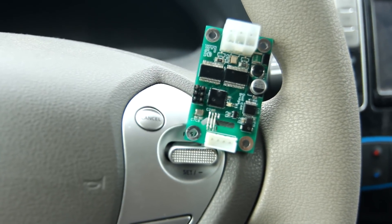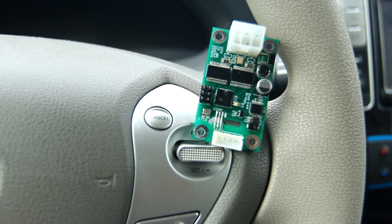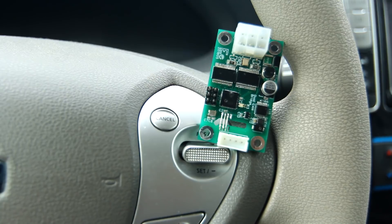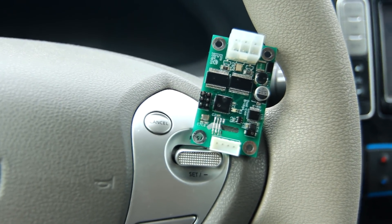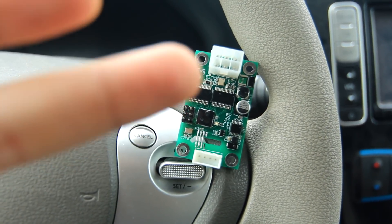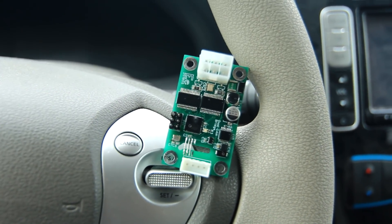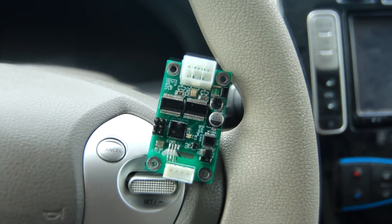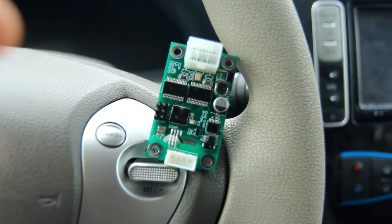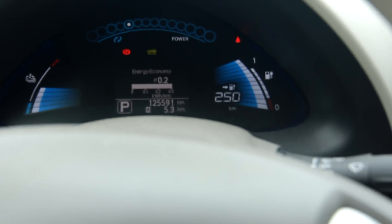The second problem is that board still has its LED on even though the car is off. The power to the VCM and to pretty much everything connected to the CAN bus is always on, and there is a wake-up message that the VCM sends to everything to signal that the car is supposed to turn on. I have to trigger on that, because right now this uses about 60 milliamps — I will definitely drain the main battery if this board and the board in the back are just continuously on. This is also why I have a battery connected to it in the back, so I don't drain the main lead acid battery.